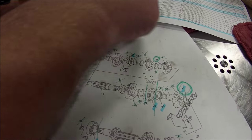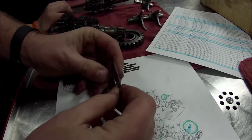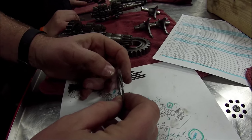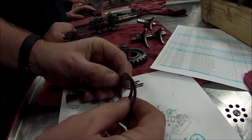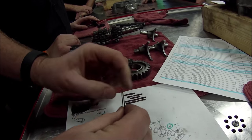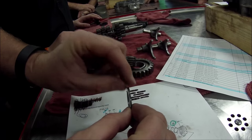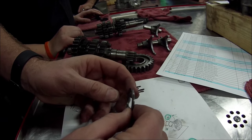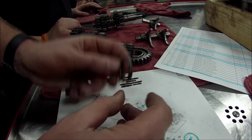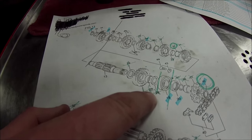And when I say same size, I'm gonna take this back apart here. When I say same size, we all know as technicians, we have three measurements, right? Three, not two, three. We have an OD, an ID, and then the thickness. So anytime you're comparing washers, we're comparing all of those because these are precision shims that are perfectly ground on both sides. This is not a washer from Baumgars, is it? No. Okay. And then I could see here, 28 and 29, guys, they're a different reference number.